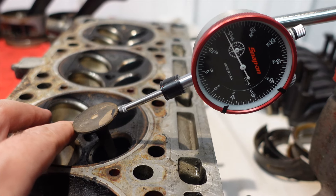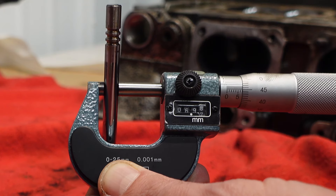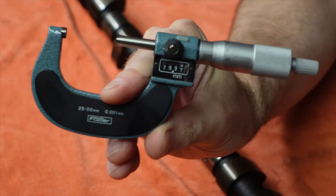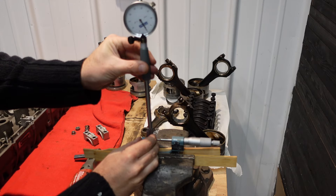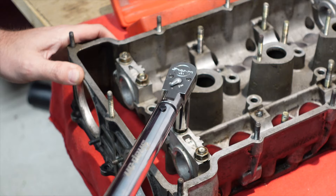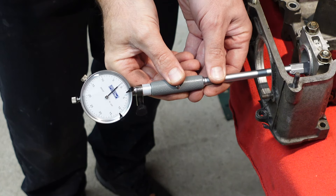The stem should be 7 millimeters across the board for all intake and exhaust valves. Next, we'll get to the camshaft journals — each one measured exactly to spec. I want to find out the oil clearances on the cam journals, so I'm going to take that baseline measurement from the cams and zero my dial bore gauge to it. I'll torque down the cam bearing caps, and the bore gauge will show me the difference, which is my oil clearance.